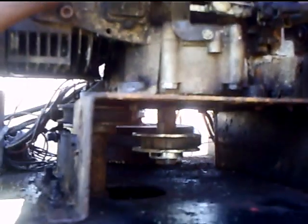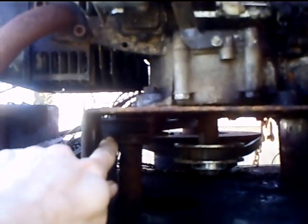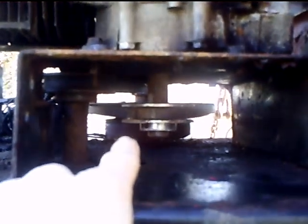This thing is just leaking gas out of everywhere, just flooding it. The carburetor is cocked. And I don't know if you can quite see it — see that pulley right there? That sucker is rubbing this plate here. The motor is sitting down too far and that pulley doesn't even line up.